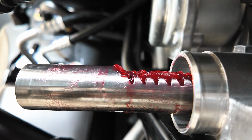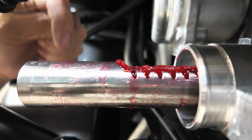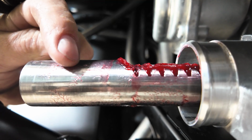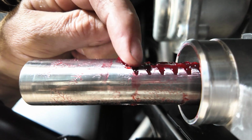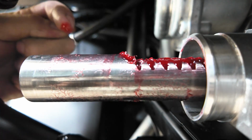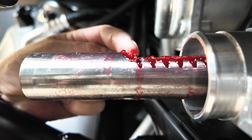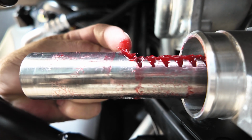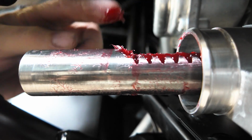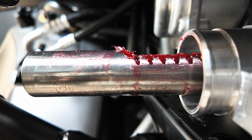So the reason the steering rack stabilizer is important is that it's actually a rack stabilizer and not a damper. It is deceiving that out here you can see it's a 1-inch shaft, but after you cut in the serrations for the actual rack and pinion mechanism to work, it drops down to just under 3/4 of an inch. That being said, you get enough feedback from the outbound wheel, it'll force in on the rack and it can fold anywhere through this partition depending on where the steering angle is and bind your steering in place.